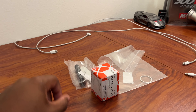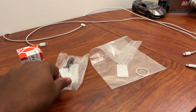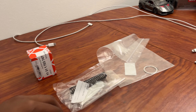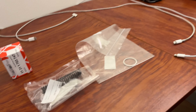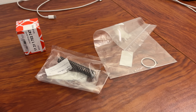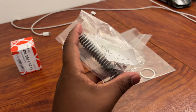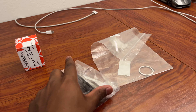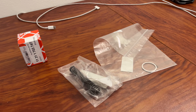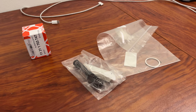Basically how this works: the mechanical chain tensioner has a piston and a spring, along with a cap on the outside. This spring applies tension to the timing chain. Over time, the spring can lose its tension — it becomes slightly compressed and won't create as much tension as needed on the timing chain. This can cause timing chain slap on startup or overall rattling, which should not be occurring.